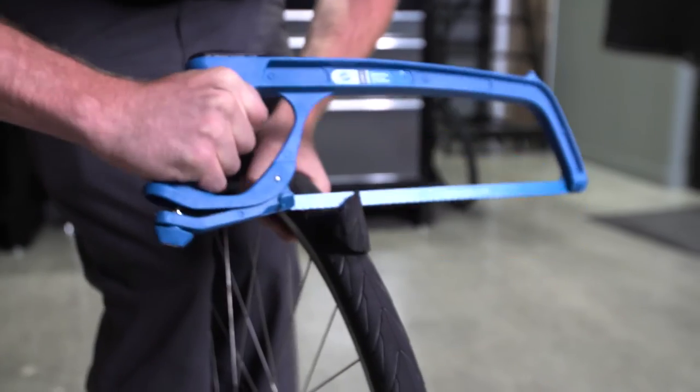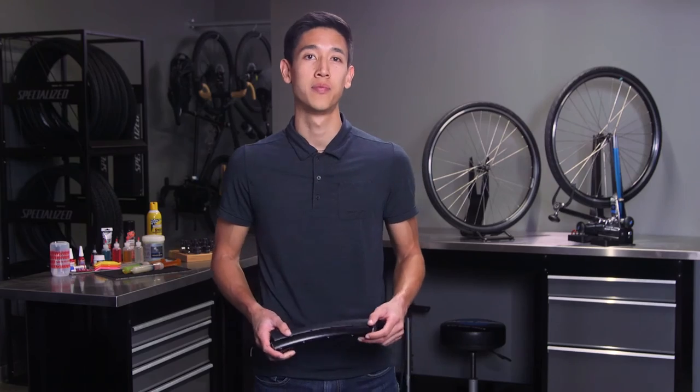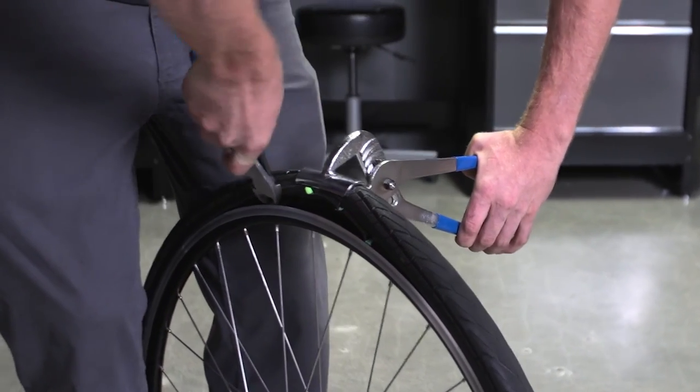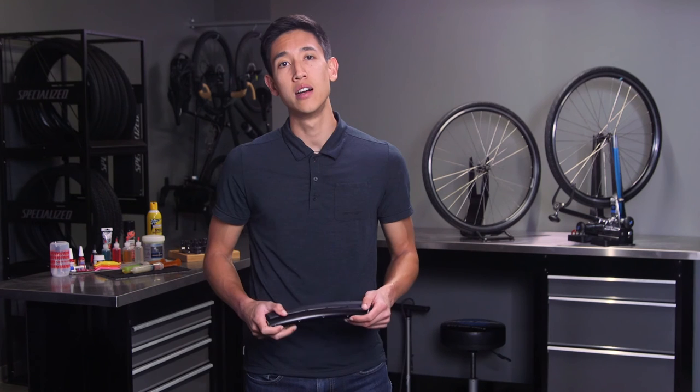How do you remove the tire? The Nimbus Airless Tire can be removed by two different methods. The first method is cutting through the tire and separating it from the rim. Unfortunately, this method does destroy the tire, and if you're not stellar with sharp objects, we suggest you take the tire to a Specialized retailer. The second method is using a bead seating tool to pull the tire over, expose the green pins, and cut them with side-cutters. This method requires replacement of the pins, but it is less expensive than cutting the tire in half.